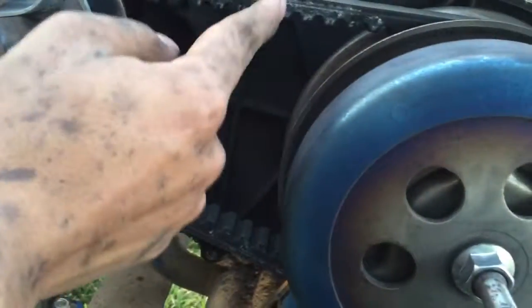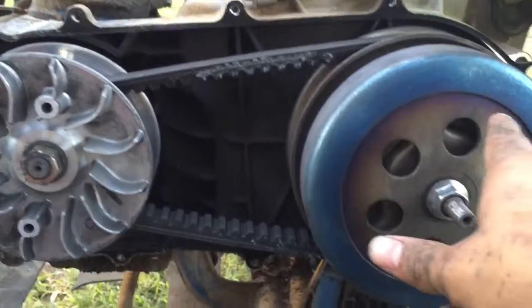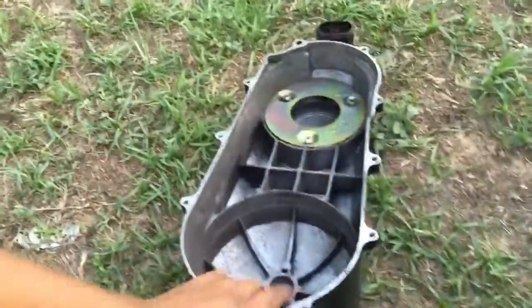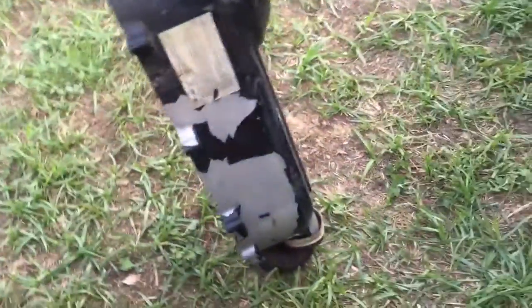The teeth are okay — looks like it hasn't been ridden in a while. You can see this part was butted up against the inside of these sheaths, but it'll be okay. It just looks like it got really hot. The gasket is perfect, still intact. I used some brake clean to clean out the inside and the breathers, but when I cleaned the outside a whole bunch of paint came off — turns out quality control isn't the best in China.